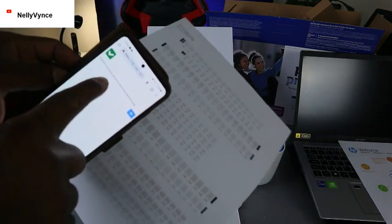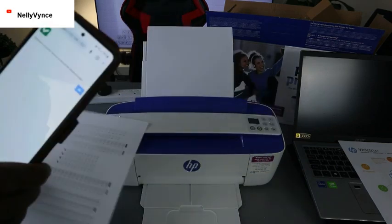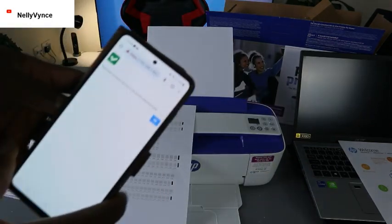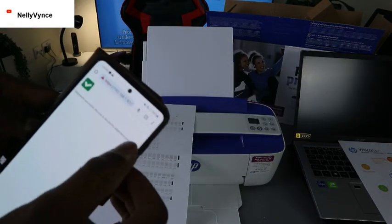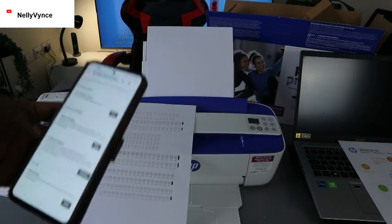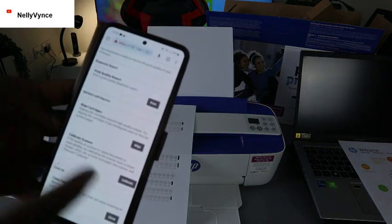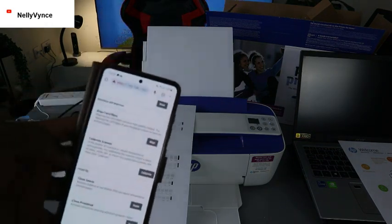Alignment successful. Recycle or discard alignment page. So this is how to align the print head, the cartridges. Then select okay. Then you can go back and do many things. You can clean smear, clean head and print quality report.